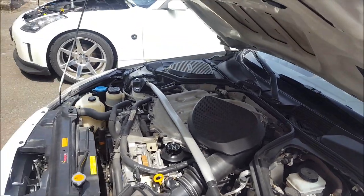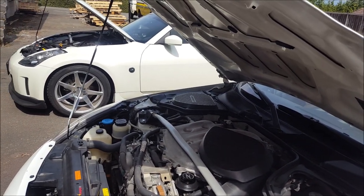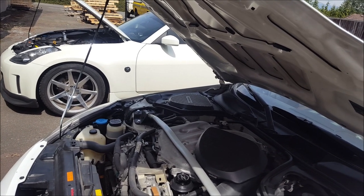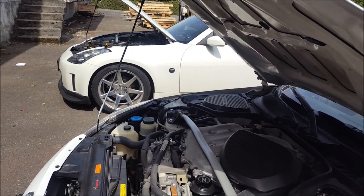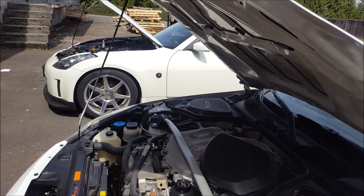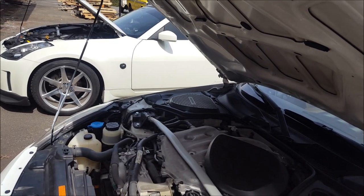The problem I always had with my car was when I would brake, it would brake really well, but the pedal always felt kind of mushy — not horrible, but kind of mushy. My 05 Silverado felt great but I did the exact same thing: new brake fluid, stainless steel braided lines, everything's pretty fresh in the car. But this car towards the threshold would just get spongy compared to my other vehicles and I just couldn't pinpoint why.